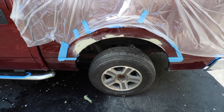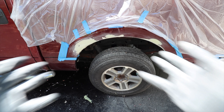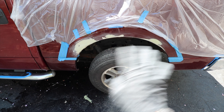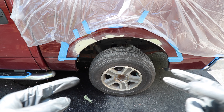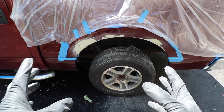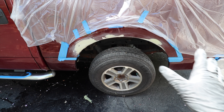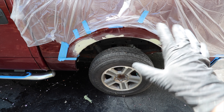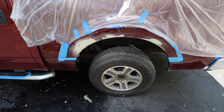You should not try this — this truck needs a new bed anyway, it's so rusted out. But I'm trying to make it better. I bonded it, I sanded it, now I'm going to prime it and then try to paint it with the same can we're painting the fenders. Because once you open that can, it's gone useless. I'm going to apply the primer and let it sit for about 20 minutes, and then we're going to start painting.